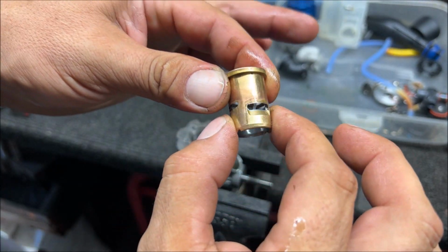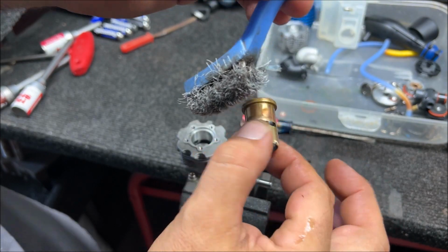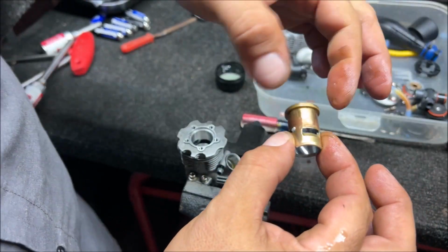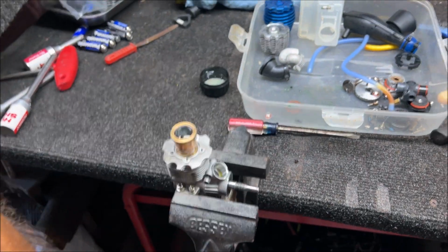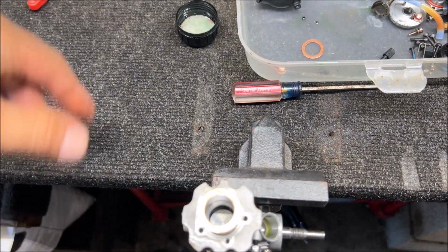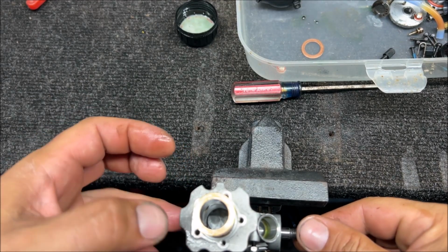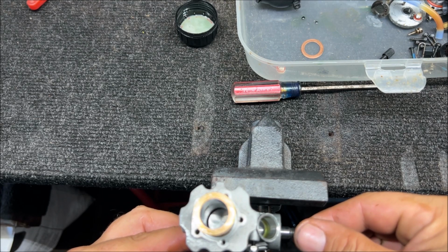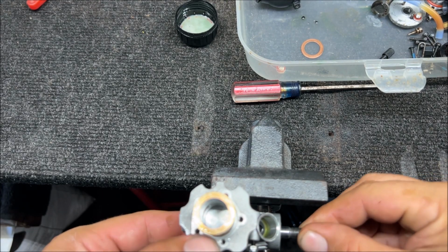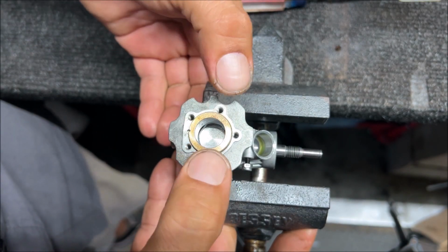The hardest sleeve I had to get out. So when I got it out, I took a wire brush and I scrubbed it. It did have that like gunky stuff that went into the cracks. Okay, so it's going a little bit. You're watching down and making sure you're not hitting that piston. Rotate the piston up into the sleeve without damaging it. So just kind of play around with it. Okay, there he goes. So once you kind of get it started a little bit, now you can try to push this down. Oh, it went right.